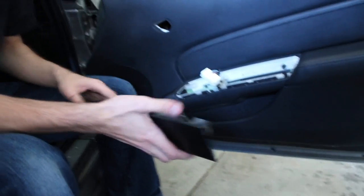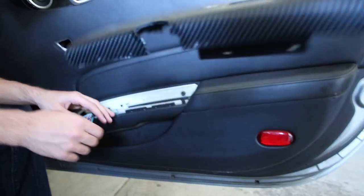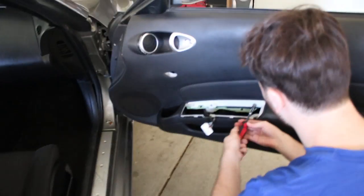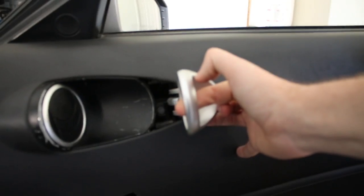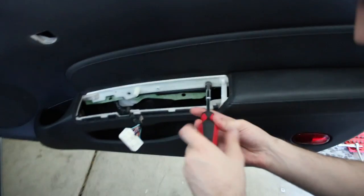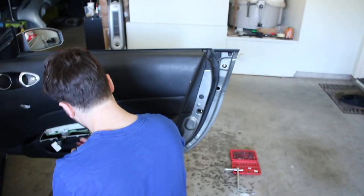Just come out yeah. You just use a knife to take it out, and there was just one cable connected to it. Pretty much all the screws on this are pretty easy — unlike my BMW where everything was a different screw, it's just 10 millimeter for everything. There's one back here on the door, one in there, two for the door handles, and one right there after you take out the control unit. After that we'll open the door panel and hopefully see the screw just sitting there.